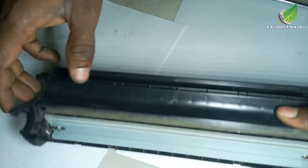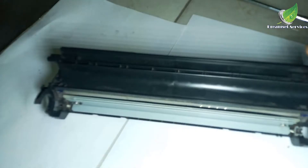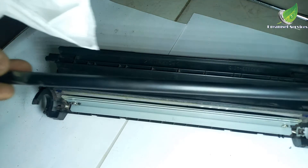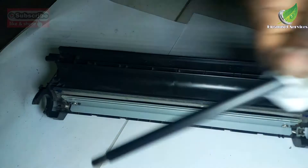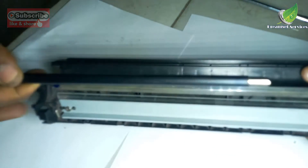So the next thing I'll go into is the charge roller. This is the charge roller — I'm going to clean it out a bit. When cleaning this charge roller, you do not use water. Just get tissue paper, and just gently clean it out. And then replace the charge roller.